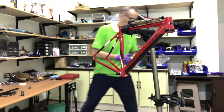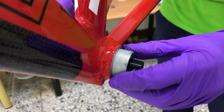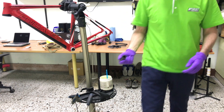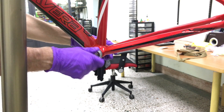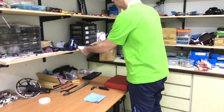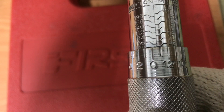Once the BB shell and the BB cartridge are flush, the torque needs to be adjusted to tolerance. Once the non-drive side lock ring is greased and installed, use the tool to finish the job. I'll tighten it to the upper limit of the range, which is from around 35 newton meters to 42. I'll set it at 42 and lock it down with the nut.